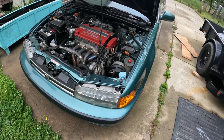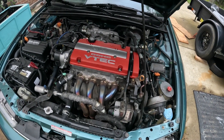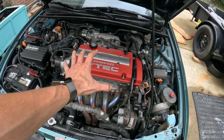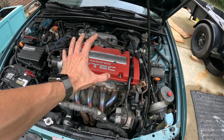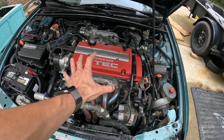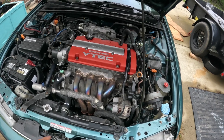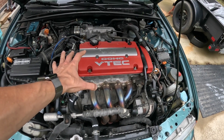Huge day for project CB9 — we'll see what fate has in store. As I mentioned, I believe I've got some excessive pressure in the upper crankcase and I've got some bad blow-by. What that means is if you've got bad blow-by, that means you've got bad piston rings. So we're going to go ahead and do a compression test on this engine.